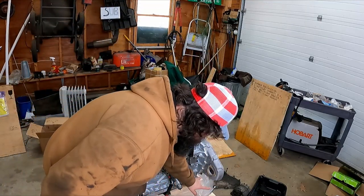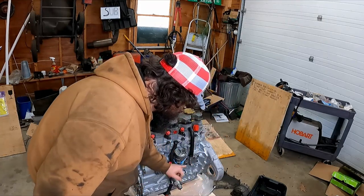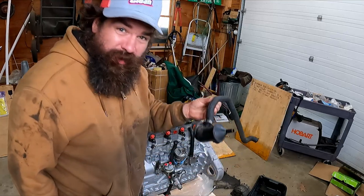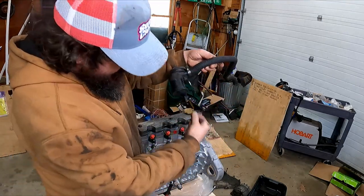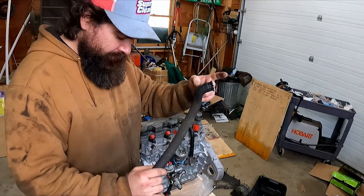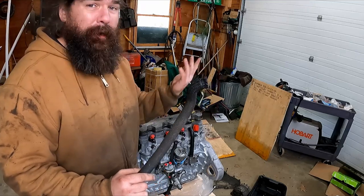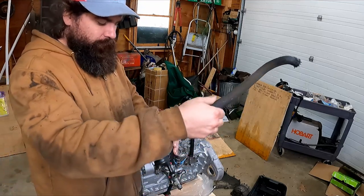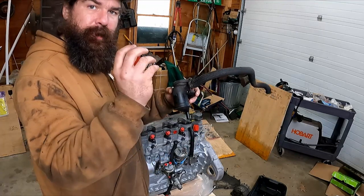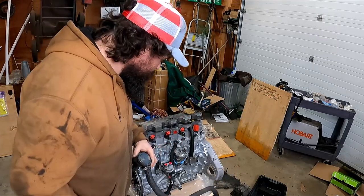We're going to put the motor mount on here, then we can put the diesel injection pump here. Then we can swap the valve covers, then we're going to install the cyclone vent — it just spins around, dumps oil back into the crankcase and then puts it into your intake. On the intake side of things, I am thinking that I might put this to a catch can. I'll probably just put the intake for now, and at some point I think replacing this whole unit with something from Alice Sport makes a nice thing that also involves a catch can, so you're not running as much used motor oil through your turbo.